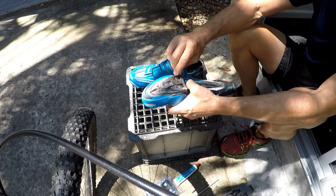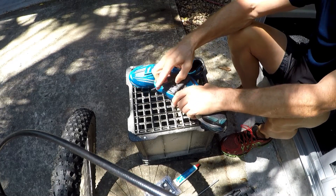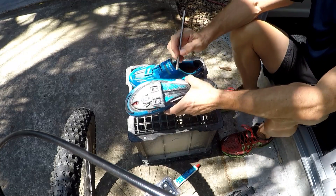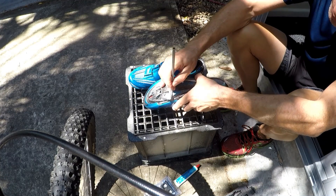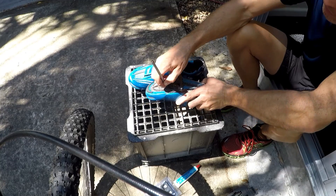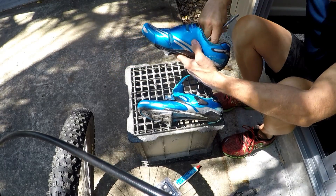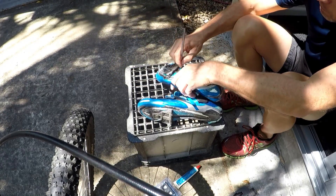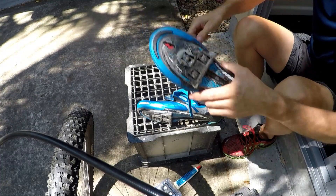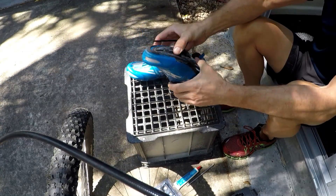Let's crack these ones off. Now, if I've done this right last time, I put a bit of lube in there so this should undo nice and easy. Now firstly I should mention — you also need a pencil. Mark around where your existing cleats are — I've already done this by the way — mark around where your cleats are, and that way you will not lose track of where the new ones have to go. You won't be guessing and messing around. Just mark on there with a pencil or an indelible pen, whatever you like.